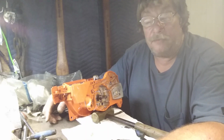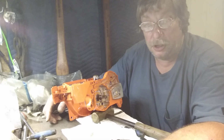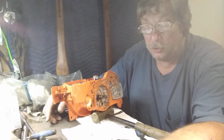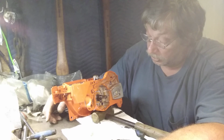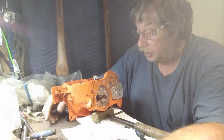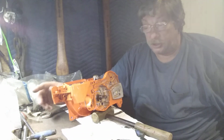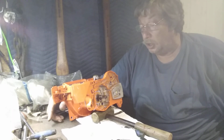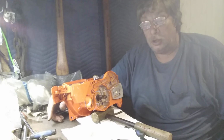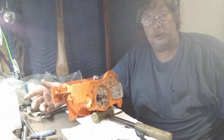Okay, I've got the cylinder partially ported as far as I dare without getting data numbers. At this point here, what I'm going to do, and we're going to continue on with GoPro on this today, is I'm going to install the oil pump, flywheel, and all that. Get your little tray here, and one thing another, and put the gas tank on. That'll probably be one video, and then we'll just keep rolling, throw the ignition in. I'll try to show you all the tricks that I can, and I'm glad you have the interest in this.